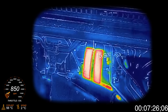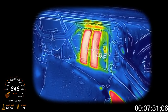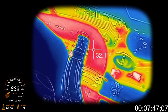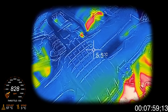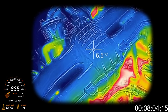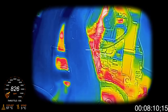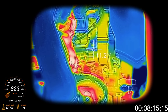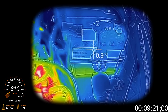Next, we're looking at the coolant lines heading to the heater core for warming up the cabin — these are at about 50°C or 120°F. Looking at the radiator hose, it's about 33°C or 90°F. Looking at the intake manifold, it's at about 6 degrees C or 43°F, consistent with what the OBD2 readout is showing at 3 degrees C. The outside air is at minus 6 but warms up as it enters the engine bay. Looking at the alternator, you can see various sections ranging from about 12 to 20 degrees C. And finally, looking at the battery — still pretty much completely frozen.